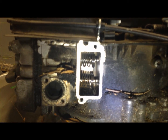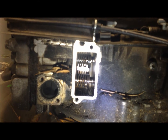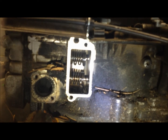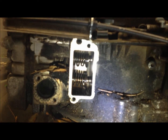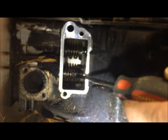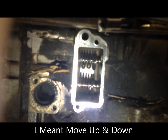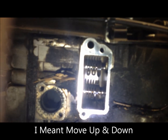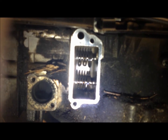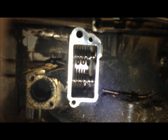So we can eliminate fuel and spark, and we thought we had compression, but I thought maybe the exhaust is clogged. I pulled the exhaust off and it sounded kind of funny, so I thought maybe the valves aren't opening. So I popped the valve cover off and we can see the valve springs — this top part is the valve on the flathead motor and the bottom is the lifter. When I pull the motor over those should rotate, but as you can see those aren't rotating. So either the camshaft fell out of position or we've got some worn cam lobes — something is going on with the internal parts of the motor, so we're going to dive deeper in and see what we can find.